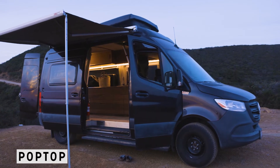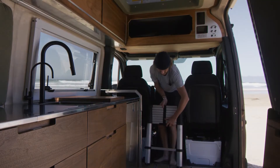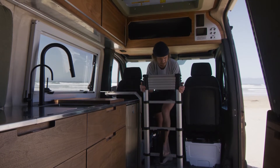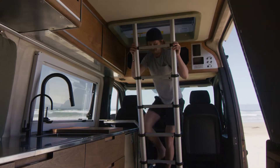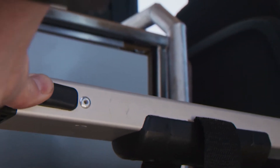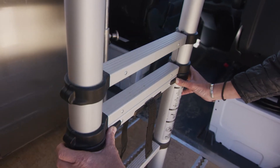Next up, let's have a look at the pop-top. First, pull the telescoping ladder from behind the driver's seat — it's important to lift the ladder from the bottom first. As you lift up the ladder, the rungs will click into place; make sure the ladder rungs are locked. Extend the ladder all the way to the pass-through on the top of the van. To collapse the ladder, push the switches at the bottom of the ladder with your thumbs and the ladder will collapse on its own.